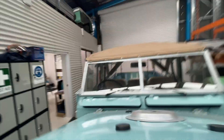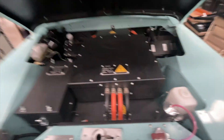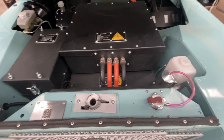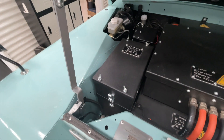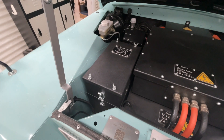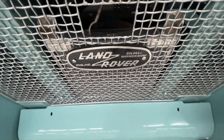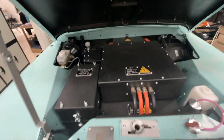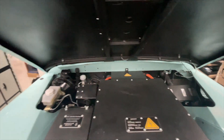If I lift this up, you can see underneath we've got a junction box on the top, and underneath that is the front battery pack. We've got the 12 volt system running a PDM — a digital system rather than fuses and relays — a few high current fuses in there, a custom radiator behind the grill, running coolant for the motor controller that you can see the cover for way up the back.